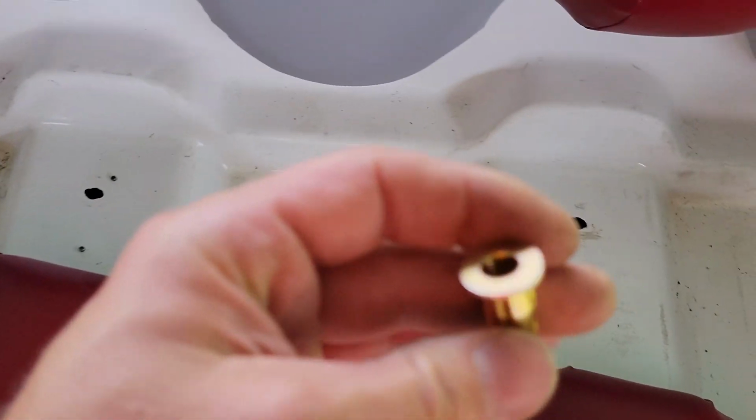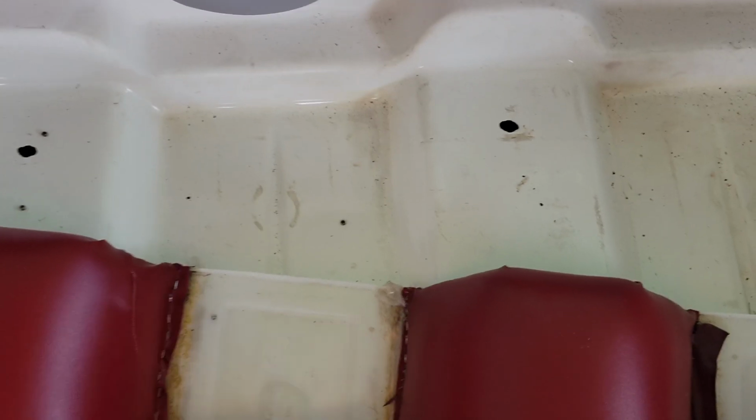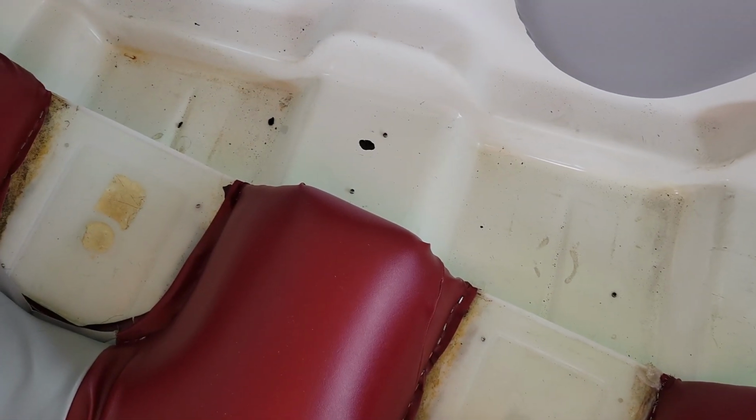There's actually 4 bolts. So they want you to have some kind of inspector gadget arms. Well, we're not doing that. So we're going to switch it up a little bit. What we're going to do is take this pretty little rib nut and drill it through the centers of each one of these, and put a bolt down this way, so it's always accessible and you don't have to do anything crazy to get it in. Let me show you what it looks like.